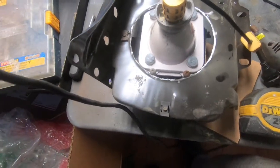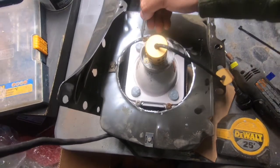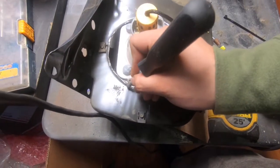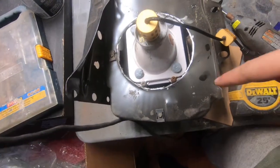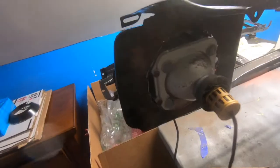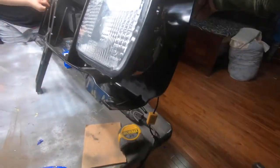Actually, not a lot — you can just make some little marks. Just a little bit there, pretty much where the bolts are gonna sit. You can see on the bottom where things are gonna line up — just cut a little hole there, maybe a little bit here, and it should be good. What I ended up doing is getting a little needle nose and just twisting all around — that's pretty much all you need to cut, and the light should bolt up pretty much perfectly.